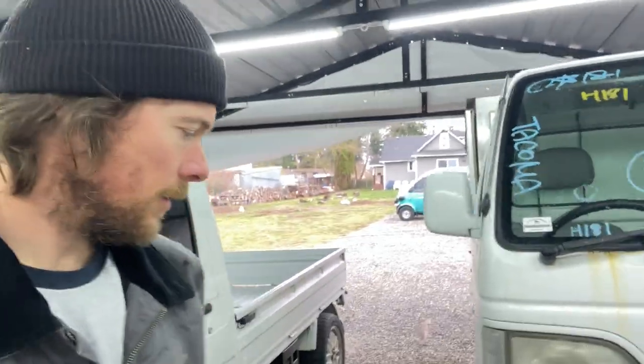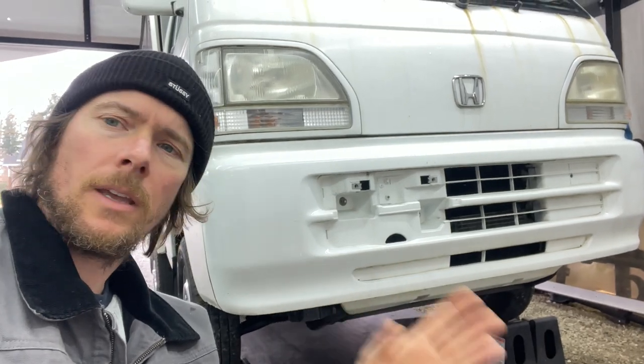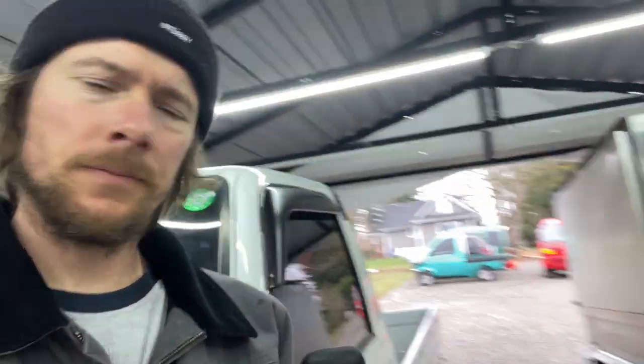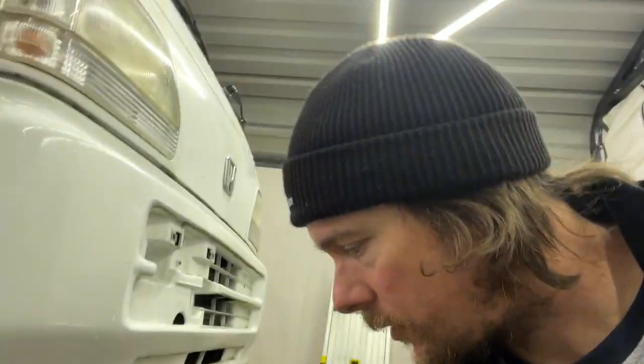The lady wanted me to give her a list of stuff that needed fixing. I did front brake pads — those were shot — spark plugs, spark plug wires, air filter, fuel filter, oil change, inspected the belts — everything looked good. The left motor mount is ripped, so I'm going to do a new motor mount on the left side. I have a video on that using the red Acti. Note: the motor mounts are different for manual vs. automatic transmissions — part numbers are different. Okay, back to the stabilizer bushings.